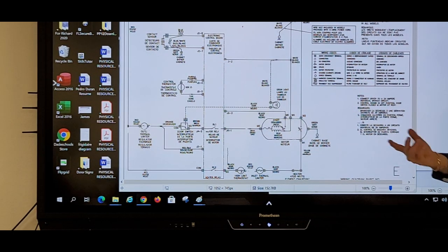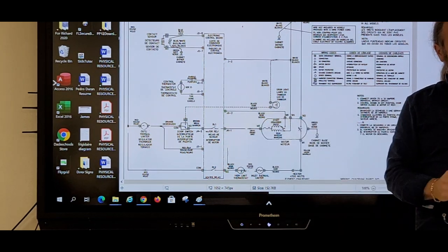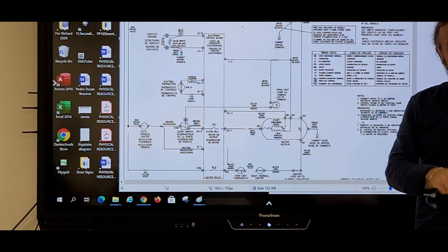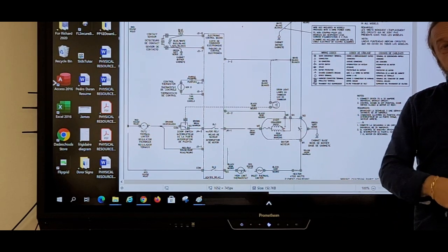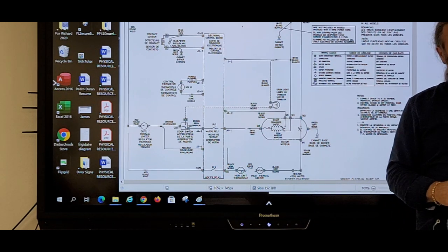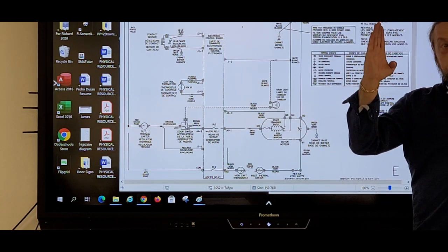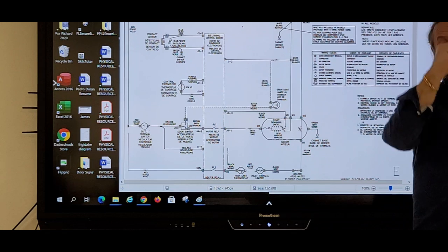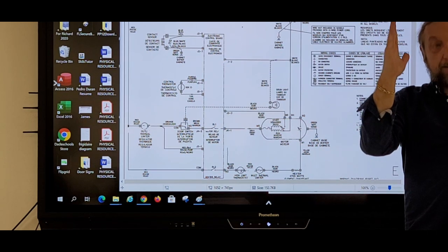Okay, so let's just say the heater circuit doesn't work. You've got 240 volts to a dryer, 120, 120. You've got power. Say you've got an outlet or a connection for a dryer, with four prongs. When you're testing, which prong do you test to get the 240? The two outside blades, 240. The one with the L shape is neutral, the round one is ground, and the other two on the outside that go up and down are 240. That's line one, line two.